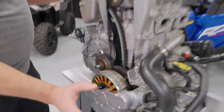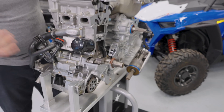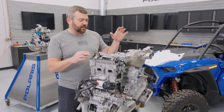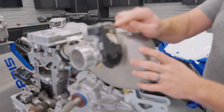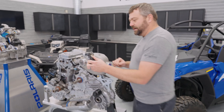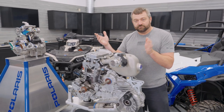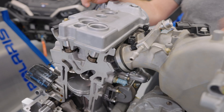Still a capable charging system here — we've got 560, 660, and 900-watt variants that package into this series of engine. This is our more modern design, a generation or two ahead. From a base architecture standpoint, the fuel injection includes an electronic throttle on this motor — you can actually see it in the cutaway. This little gear at the top is connected to the electric motor; as that spins it actuates a bigger gear that opens the butterfly inside the throttle body. It's a single throttle body feeding air into both cylinders on this engine, as well as the one in the RZR behind me. Still got injectors going into the intake ports — still fully fuel injected.